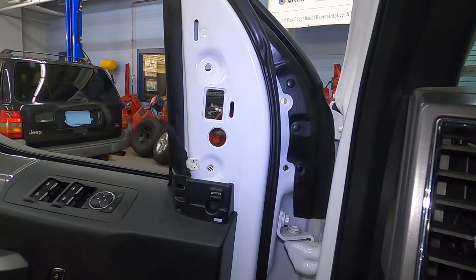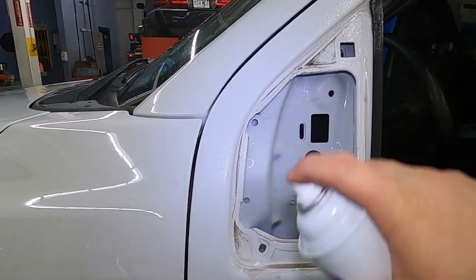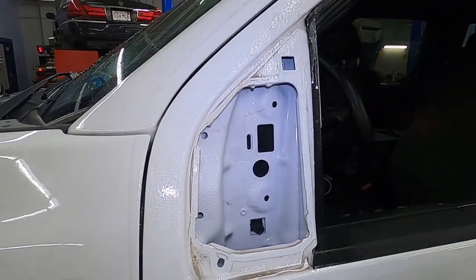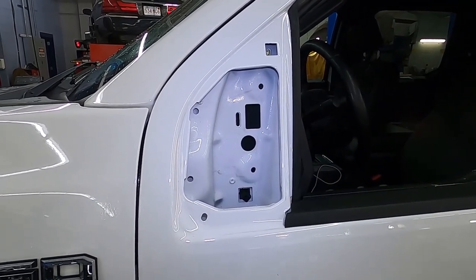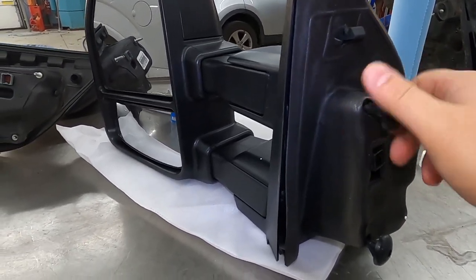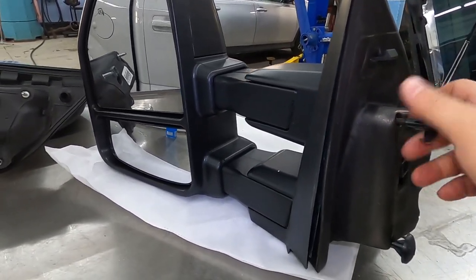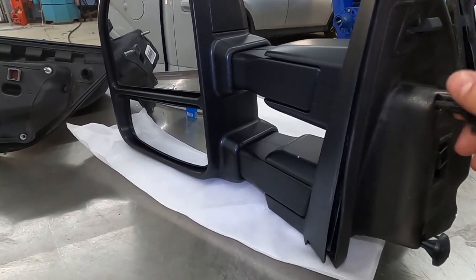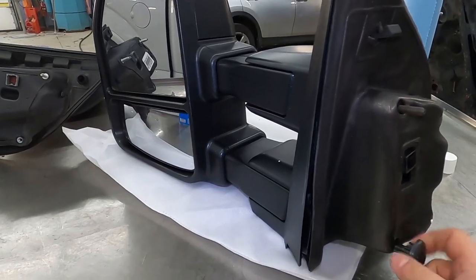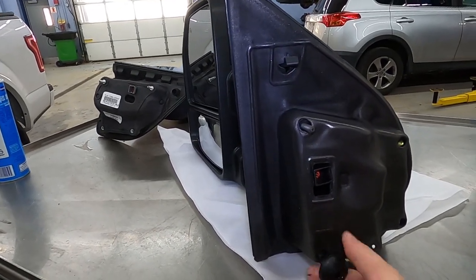There's one little clip that holds it in place, but once it's off it's pretty simple. Before you put the new mirror on, do yourself a favor and take a little glass cleaner to clean where the new mirror is going to rest. Once cleaned up, you're ready. The new mirror has a couple of thread protectors to remove first — check to make sure everything is intact and there's no shipping damage. I'll leave a link in the description; these are an aftermarket unit purchased off Amazon and a pretty good quality product.